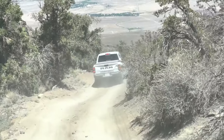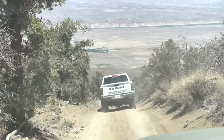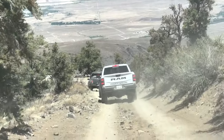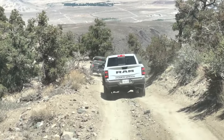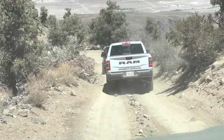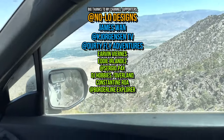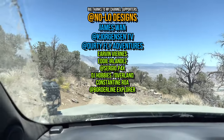So anyways, thank you very much for watching this episode. I hope you found it informational and you learned something. In a unibody all-wheel drive, skid plates should be your first or second upgrade. It's tied with terrain appropriate tires. In my opinion, it should be the first upgrade, because with a tire, let's say you get two flat tires, your buddies could always drive into town, get two tires, drive back up, and you're good. But if you bash your oil pan, you lose oil pressure, you don't realize what happened, you keep going, and then your engine explodes. So I would definitely choose having to replace a tire over an entire engine.